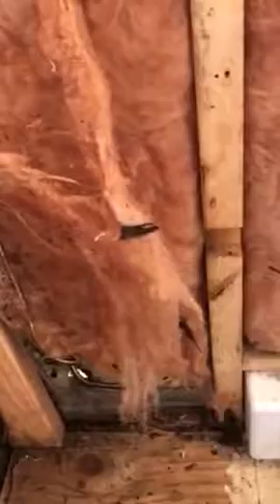There's no ethics when you talk about these people. Bottom plates are completely missing — that one's rotted and missing. This plywood they put in — you can see all the pieces — it wouldn't have been done that way from the factory. They tried to do a seam putty to seal the seam, but you can't seal the seam in an RV because the thing's driving down the road, twisting and creaking.